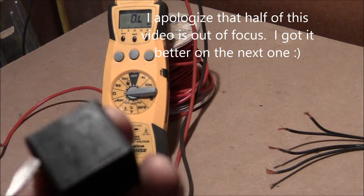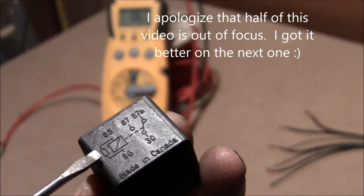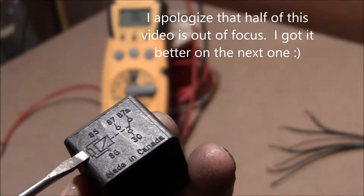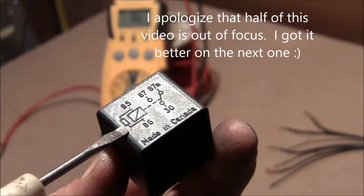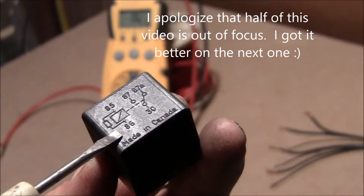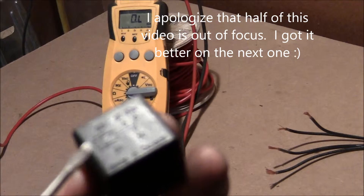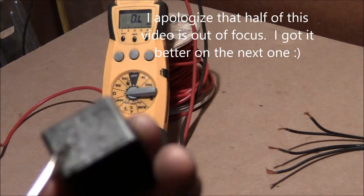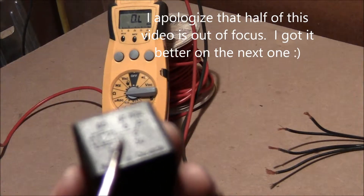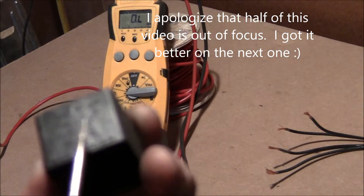You have this diagram where it shows the winding — that's the control side of the relay. It's terminals 85 and 86. That's what's gonna activate that field coil. And when you have that circuit going and it's got power, it's gonna pull that plunger in over here.